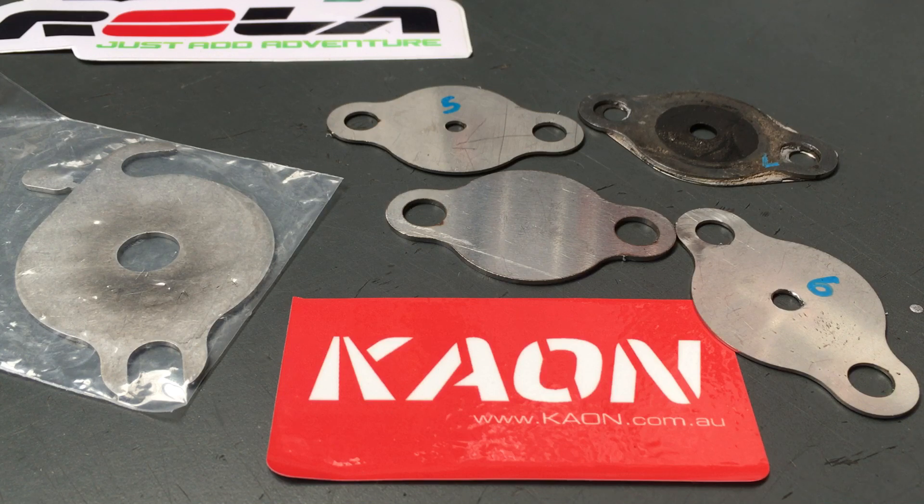When you put a plate in, you need to clean the EGR system — at least the EGR cooler — and make sure everything is functioning normally. As the vehicle gets older, things aren't working like new. Components have been fed exhaust gases all their life and need to be cleaned and freed up. Make sure there are no leaks, vacuum lines go on correctly, and everything is right. That's usually going to sort out any issues.